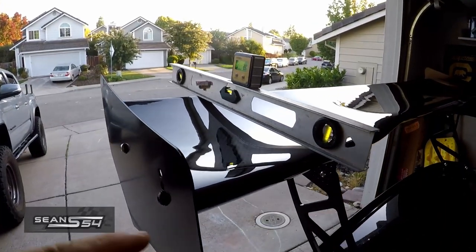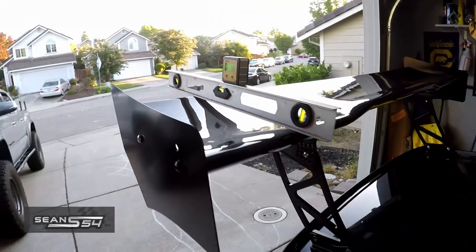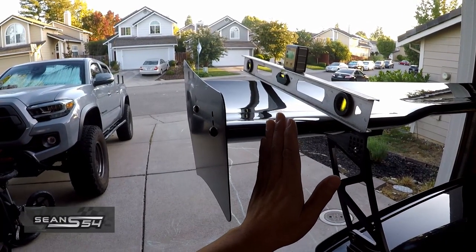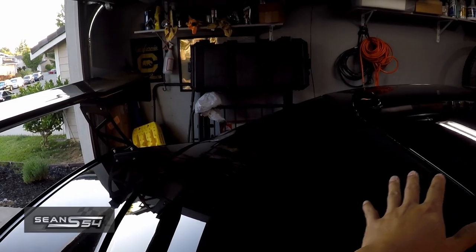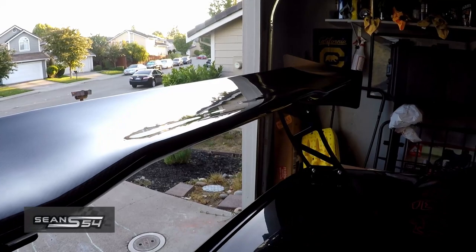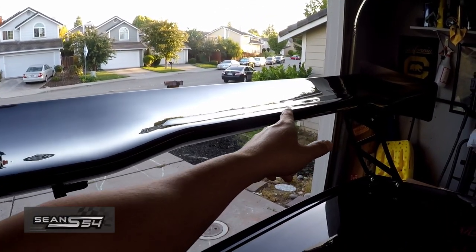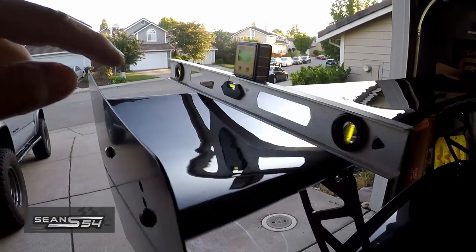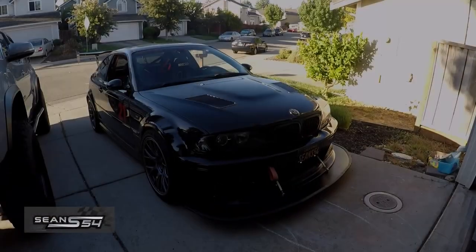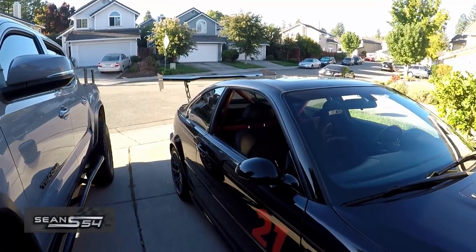The outside angle of the 3D wing is about 4 degrees, and the air off the side of the vehicle is a lot cleaner, so you may want a more aggressive angle of attack on the outside of the wing. The air coming off the roof and the back windshield is a different airflow, so you might want less angle of attack there. That's the idea behind the 3D wing. Right now I have the center at about 0.6 degrees and the outside is naturally at about 3.9 degrees angle of attack. I can't wait to try this out on the track next week! Hope you guys enjoyed the video — please like and subscribe, thanks for watching.